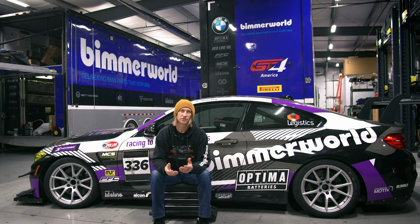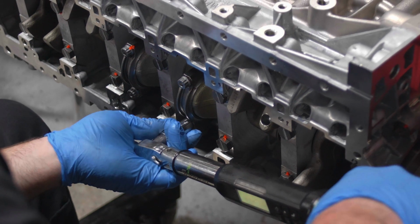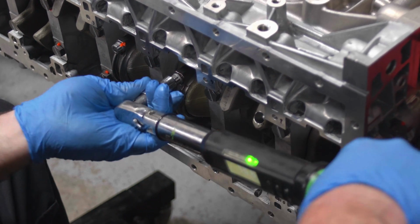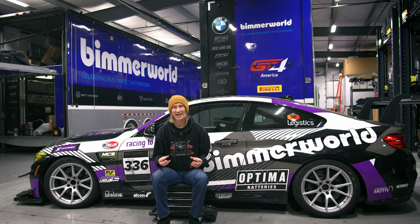And then there's two options on connecting rods for the CP rods. There's WMC bolts or CARR car bolts. The car bolts are for super high power applications. For what we're doing with this, while it is high power for a track car, the WMC bolts are totally good, so we went with that option on this one. We did WPC treated rod bearings, and WPC treatment is something we've done with rod bearings for a lot of years, and that helps reduce friction, helps oil stay retained in those bearings to help keep it protected and just help take the abuse.